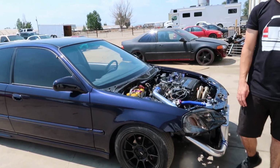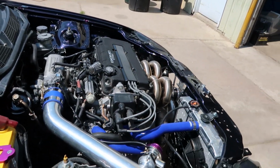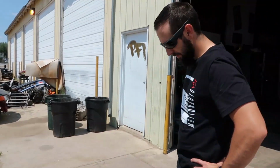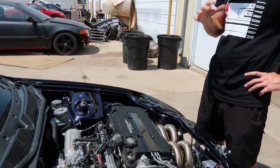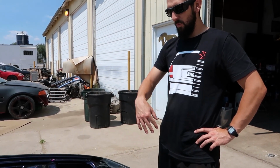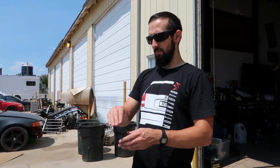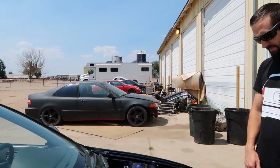It's got a 5-pound spring in it, so awesome. We might have to throw some T's in it, or a little boost control of some sort. Maybe, we'll see how it acts. Would be cool, but I kind of want it to stay just stock B16 and good running. On 1 pound, I just eased into it, 10%, and I had the boost cut at like 1.2 pounds, and it hits the little cut. But man, it felt great even like that. This is gonna be awesome.